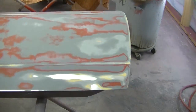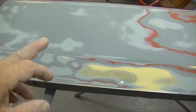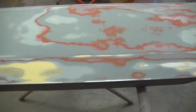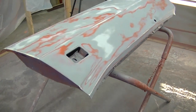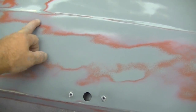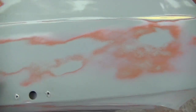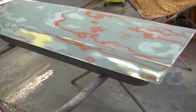Your feather edge is color. You've got a dust coat — you've got to put a real thin layer on and let it flash, maybe 15 minutes, then go back and put another coat on. A lot of guys will go straight to color, but I'm not. I'm going to primer first, and if I'm not happy or if I break through the primer, I'm going to seal it too, because everything was sealed on this car with a dark gray sealer. The light gray is the sandable primer I'm spraying on; the dark gray is the non-sandable sealer. I spent 45 minutes sanding this door with the DA and that's as far as I could get. There's a coat of dark sealer underneath the red paint, one coat of red base, spot-primed areas with light gray, and then a coat of dark gray sealer over everything again — just filled with mils of paint. So I took it down to 240, then I'm going to prime it and sand right to 400-500.